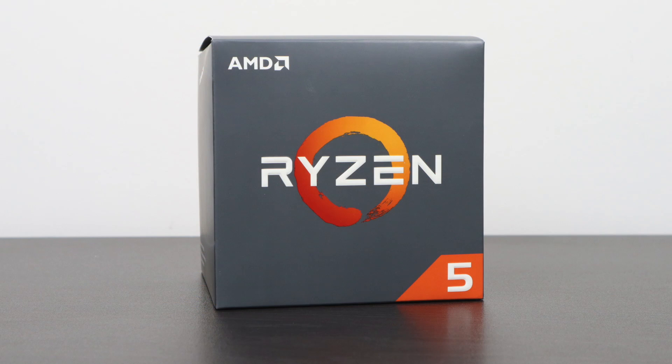I'm actually putting this PC together for a friend, so I'm going to go over all the parts I'm using, then we'll do a little bit of a build and then we'll get into some benchmarking, power consumption, and heat. For the CPU I'm using the AMD Ryzen 2600 — not the X variant, the regular 2600. Base clock of 3.4, boost of 3.9, 6 cores, 12 threads. It's a great CPU and on sale online for around $150 to $160.